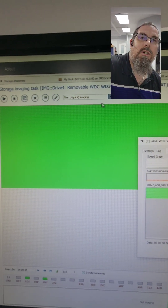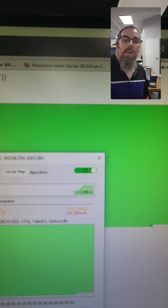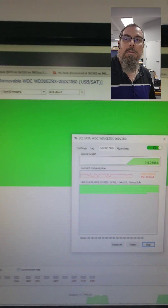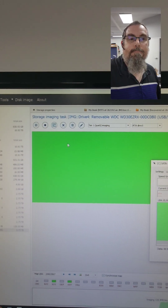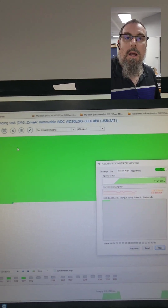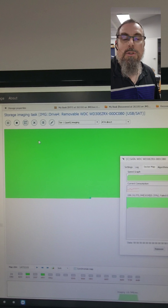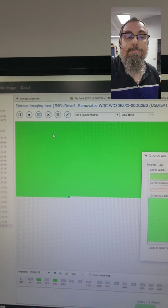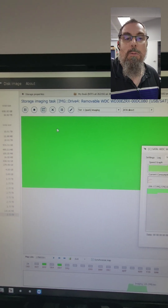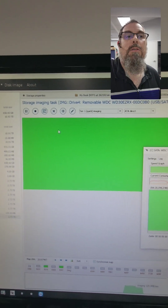We'll leave it at quick imaging because I think it's fine. Click Resume. And sure enough, we seem to be getting a fairly decent transfer rate. So that is using UFS Explorer to both create an imaging task and to clone a Western Digital drive that is encrypted, doing the decryption on access. This way we're only imaging the targeted data. Theoretically you could have imaged the whole drive first and then gone back to do the decryption and copy the files out from the clone, but this way we're targeting about two terabytes of data, saving us from having to image three terabytes, which speeds up the recovery process.